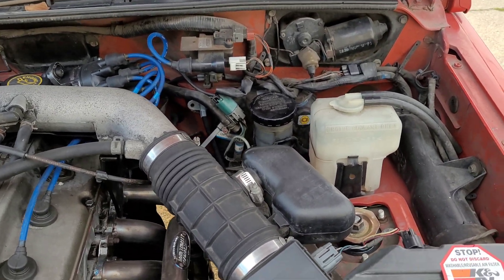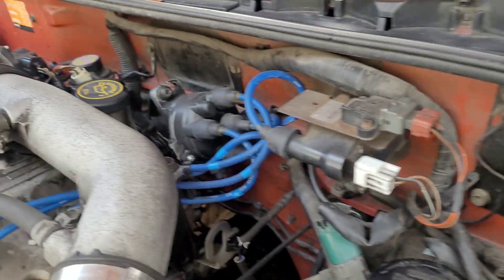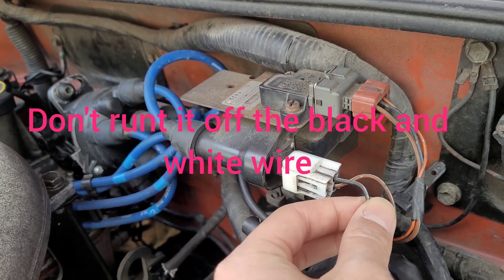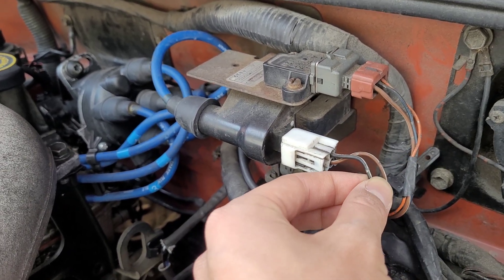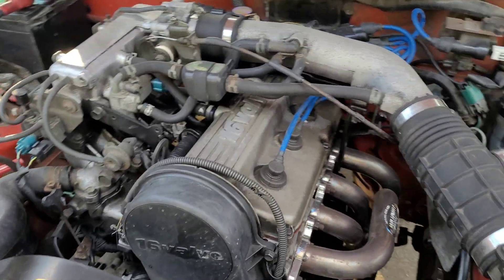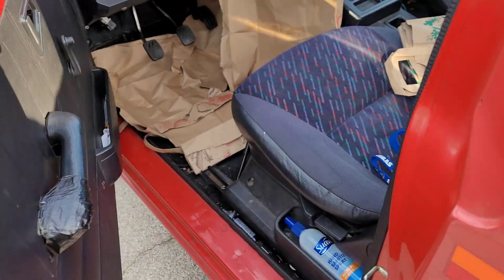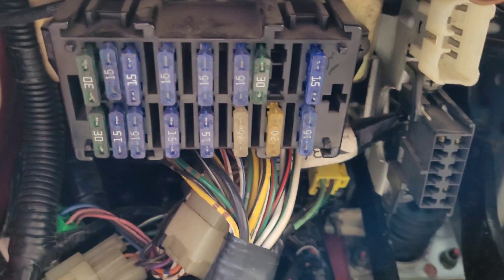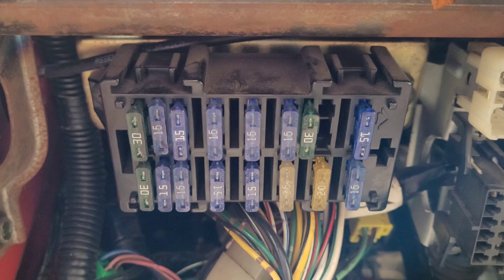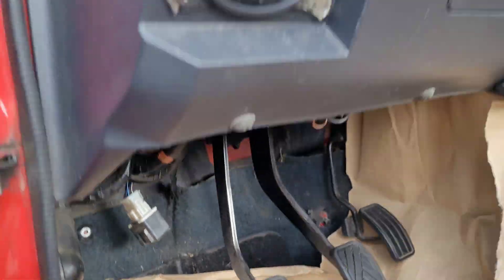The way we're going to connect this: we need one wire coming off the ignition coil — we're running it off the negative side. Important correction: do not wire it to the black and white wire; you want to wire it to the red and white wire. We also need a source for power, a source for lights, and a ground. The fuse box is right up under the steering wheel, and we'll get the power and lighting supply from fuses there.